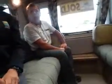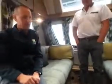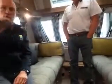So in winter we leave that open then? Yes, that's it. Make sure you drain it for winter. Also before you switch the water pump on, again, check the drain switch and make sure all your taps are shut. Because you've got a bathroom in there with an integral shower as well as the toilet area. If you've left that on, you get all that wet. Even though it's supposed to be a shower, you don't want water just pouring out. So make sure they're all shut.